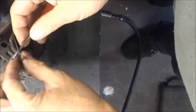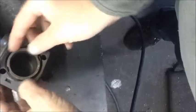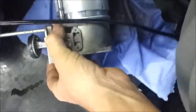So make sure there is no dust from the old piston seal. Clean out the bore. Then you need to fit the O-ring, so you can remove the O-ring from the cylinder head. I'll just get a proper screwdriver. Fit the new O-ring in the position like so, and now you need to position the cylinder back onto the piston head itself.